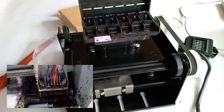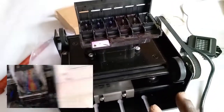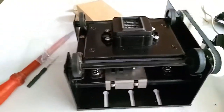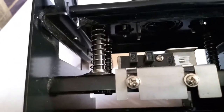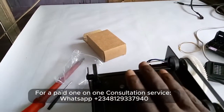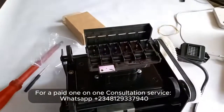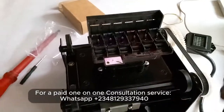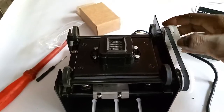Once you change this cap you get that vacuum secured between the cap, the printer head, the tubes, and the tank, and that way when you pull you can clean your printer head properly. In this video I have tried to show you why your printer head is drawing lines from the angle of the capping station. As sophisticated as it looks, all this does is pull these levers down so that the printer head can move freely when it approaches or leaves this place.